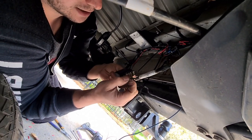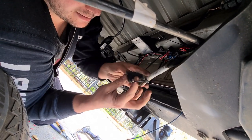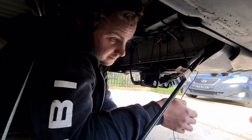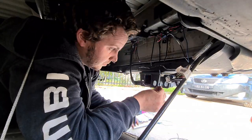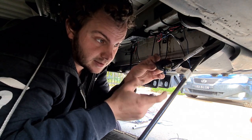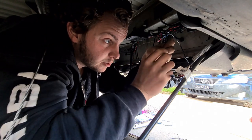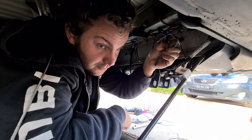This is the trailer plug wiring which is aftermarket. I need to get the black wire - which is this one here, very convenient - and cut it and put a wire into it. I've cut this so you can plug it back together. I've disconnected them and this wire plugs into that one, and then this wire plugs into the wire coming from the relay. Your reverse lights for your trailer will still work, and this wire will be powered for the LEDs.